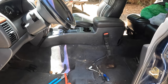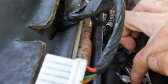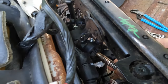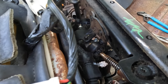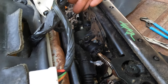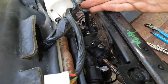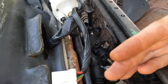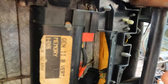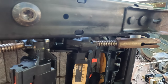We just took the seat out, so I'll flip it upside down and work with it this way. You can see this is the screw that this motor rides on — there's a front and a rear. I was able to get my pipe wrench on there and get them to turn about a quarter inch, so they're at least not seized. Then I switched the wires between the two: the rear one would make noise but not actually rotate; the front one wouldn't even make noise. I also filed down the threads I'd boogered up with the pipe wrench and put some more lube on both.